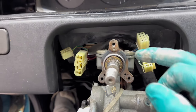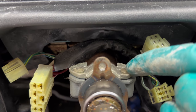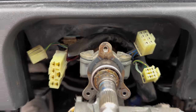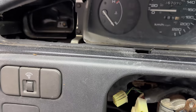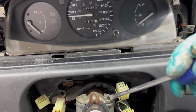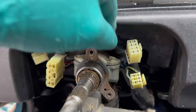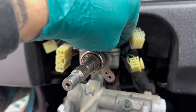Next is the switch itself — you can unplug it underneath here. To get these safety bits off, use a hammer and chisel or a hammer and screwdriver and bang on it at an angle, counterclockwise. Put the screwdriver on an angle like that, and then bang on it counterclockwise. Once you crack it fairly loose, you can use your fingers to get the safety bit out.